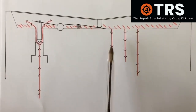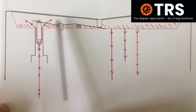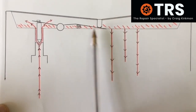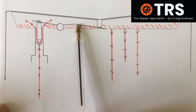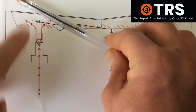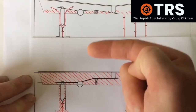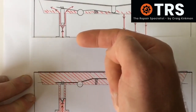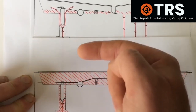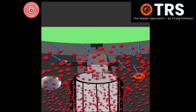Here's what it does when the engine uses a lot of fuel. Let's say we've opened up the throttle — we've pressed the throttle trigger and it's needing lots of fuel. Fuel's going into the engine, so fuel has left this area. When it leaves this area to go down into the engine, it creates a vacuum and pulls this diaphragm downwards. When it pulls it downwards it pulls down the metering lever, pushes against that spring, and operates the lever — it lifts the needle off the seat and allows fuel to flow in. It's not an all-or-nothing event; the diaphragm is moving intermediately. It's right up if the machine's stationary and not working, and right down at full throttle. If the machine's working at a medium pace, the diaphragm would be somewhere in a mediocre position allowing so much fuel in, and so that allowed the fuel to flow into the metering chamber.